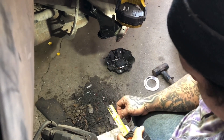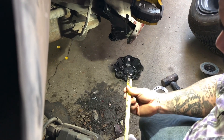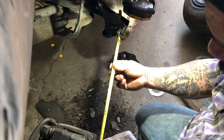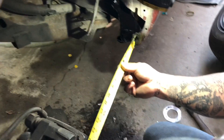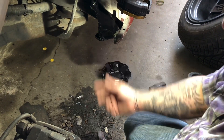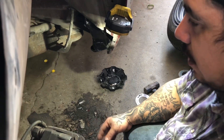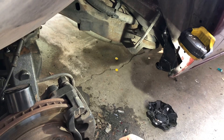I already got it spray painted black — all you're doing is just protecting it from any rust buildup. Now we're going to measure it. Remember when we measured the first time it was 14 inches, so now we're going to measure again from here to the brake caliper. We gained a whole inch — now it's at 15 inches. By doing this mod you're going to gain an inch more of clearance, which to me is perfect. If you're running bigger tires you might need to push it farther back.